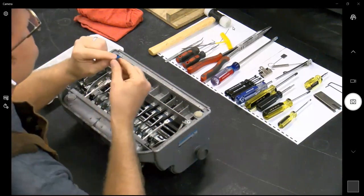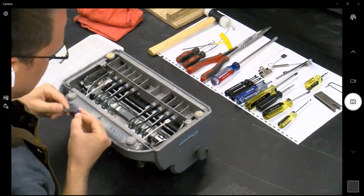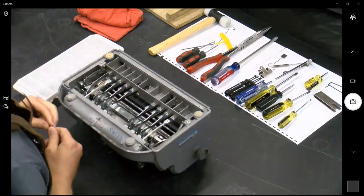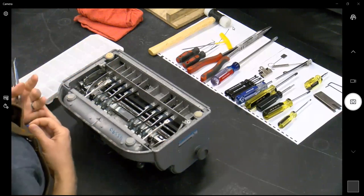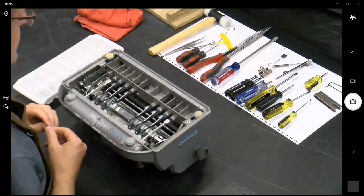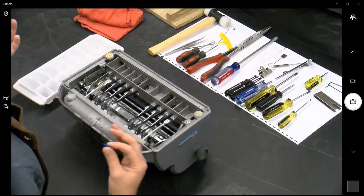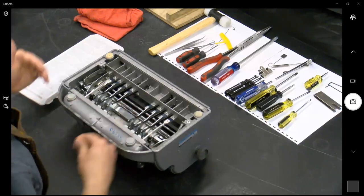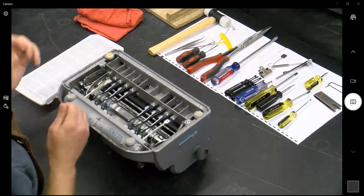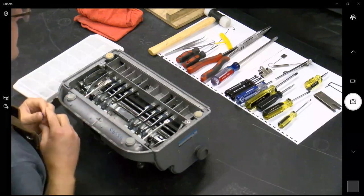The cleaning process solves about 60 to 80% of brailler problems. What we're starting to do with our fleet of over 300 braillers is getting them back in on a yearly basis to blow them out, clean them, and lubricate them — keeping those parts from squeaking and rubbing against each other. Parts don't like to squeak; parts don't like to rub against each other. We want to make sure they're nice and clean and nothing's binding anything up.